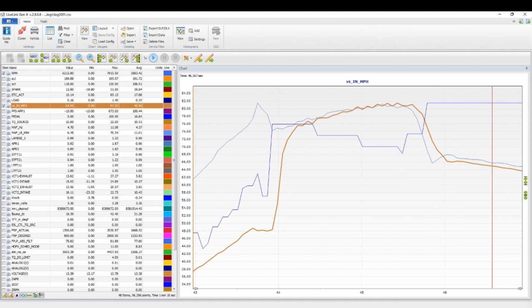I was like, oh my God, this thing is coming on pretty hardcore. So I had to kind of catch myself. But that's basically it. I mean, I took care of the cold air situation. It didn't come in and cause an issue with false knock. I don't think the little shroud that I removed was a problem, but I did take the hood insulation off because it allowed me to clock the intake a little bit and give me some hood clearance, because these hoods are a little shorter and closer to the engine than the 15 to 17 S550.